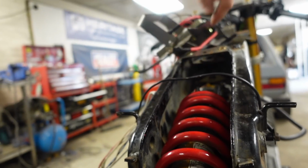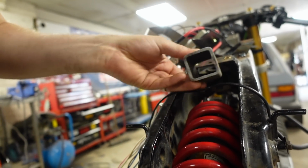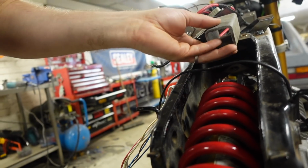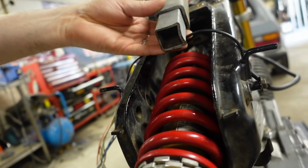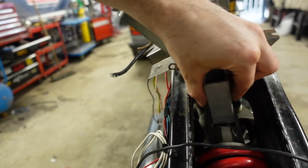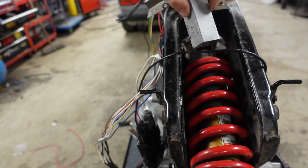this top point here, where this bolt goes through, you've got a plate here and a plate here. What I'm going to use for there is some 40mm box that's going to be shaped to fit. We'll box it all in and cap all the ends and everything off. That's going to have a tube welded through the middle. That's going to go and weld in up the top. What we're going to then do is sleeve it with a piece of not bent 30mm, because 30mm is the bang on right size for that. And we'll do the same again. We'll sleeve it through the middle so it's nice and strong, cap the end off. Nice solid weld.